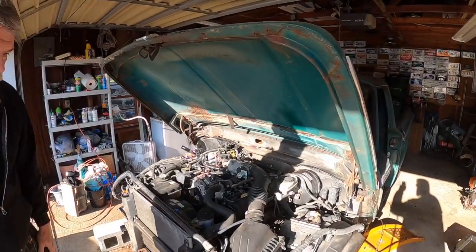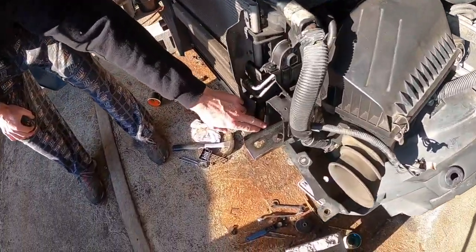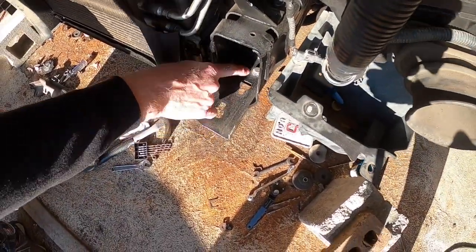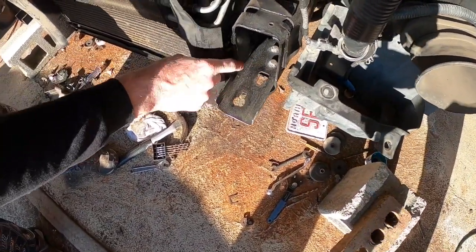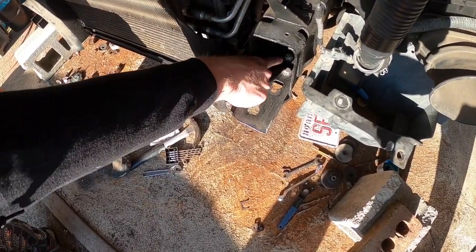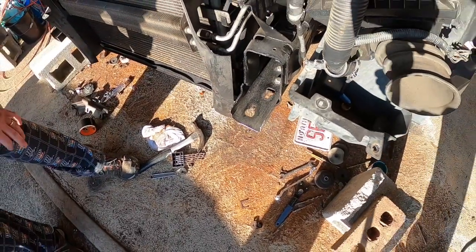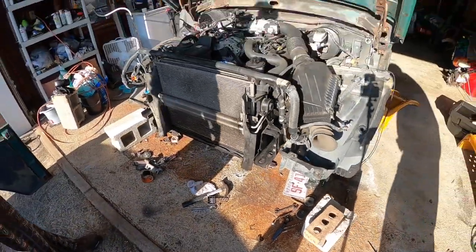Okay, since the last time we were here on Pickle, if you can show in here, Labe, inside this right here, we actually moved those back and I welded, because before it was coming up through here. I was going to be in that one and then another one, but we decided to move this further back on the bottom support and weld two nuts down through so we could bolt that support to the bottom. So I'm getting us another inch and a half further than just the original flip we did. That was something we had to figure out after the fact.